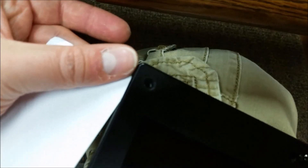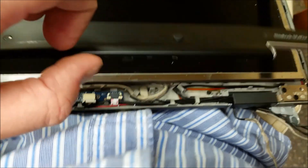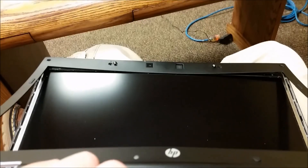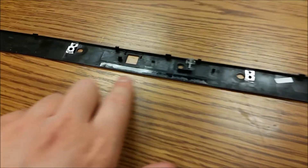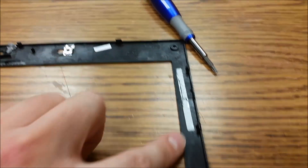This one's a little bit tougher than I thought. I started on this edge right here, came right off with my nail, and I was able to get the card just a little bit in and then take it down. You could also use a guitar pick, but I get a little more grip on a card on the bottom. Those look like there are screws there, but there are no screws there, so we're good on the bottom. And we have liftoff. The reason I was struggling on the top here is because you've got adhesive right along where the webcam is. There's also adhesive here and here, so if you feel like you've got a lot of pressure when you're pulling, this is why.